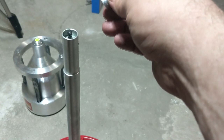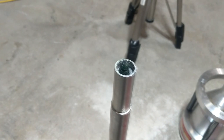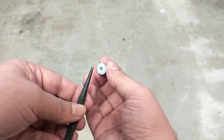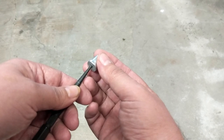Compared to this one — I was trying to get it shaped like a nail punch, but it takes a long time and the metal is really hard. The goal is to achieve a shape for the pin that matches this bushing with the dimple in the middle, so the pin goes to the bottom of that hole without hitting the sides, creating a true central pivot point for the balance.